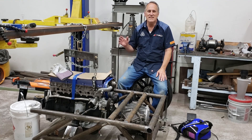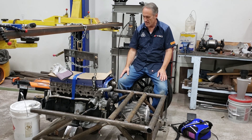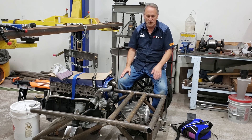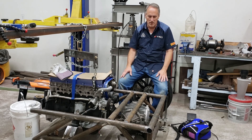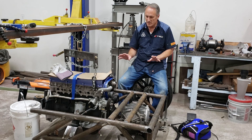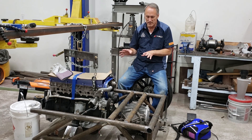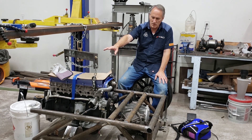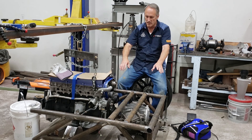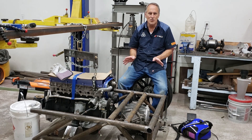Today is the day, and things are a little different — rather than hiding behind the workbench, I'm out here in the rolling shop. The subframe and engine differential are all sitting here. The basic rear subframe is welded together, the front one is coming. I'm starting to fit components together, building engine motor mounts and differential mounts. Once those are complete and the major components are tied in, it'll be a matter of putting on brackets for the turbochargers, bringing the exhaust system back, and adding suspension pickup points.